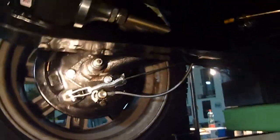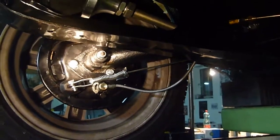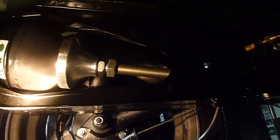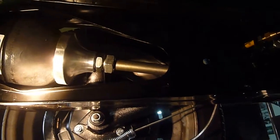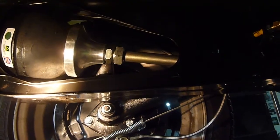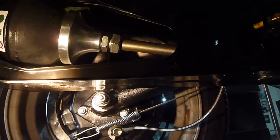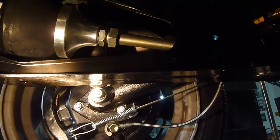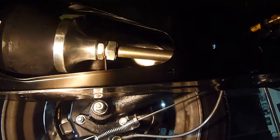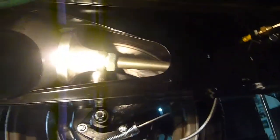So this is part 10, this is the last part. There is still quite a few bits and pieces to do, but I just thought I'd show you where we are. So there's the high-low suspension. It's on the bottom, so there's no adjustment on it at all. I haven't put any adjustment on it. It's at the lowest point basically. And when I check the ride height, there's about 3 mil from left to right. There's plenty of movement there. And as I say, one millimetre from the aluminium onto the nut is 6 mil in ride height.